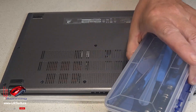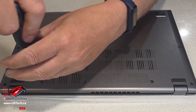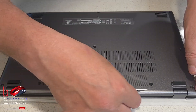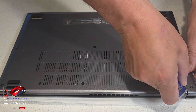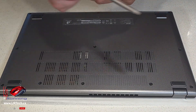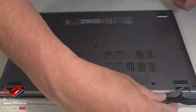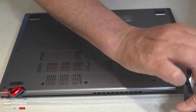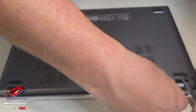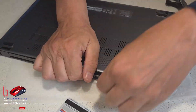Let's disassemble this. As mentioned, we have specialized tools but you don't need them — you can simply get away with a Phillips screwdriver, as these are all Phillips screws. There's no obvious pry point, so you get into a corner and pry it up. I'll use a pair of scissors just to show you don't really need a proper pry tool — pry it up at the hinge and then slide a credit card along. This is better than most Dell Inspirons because it's anodized aluminum, not plastic.